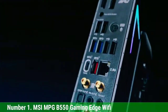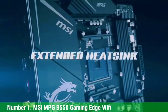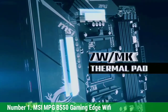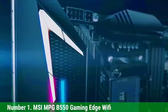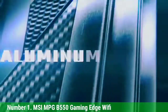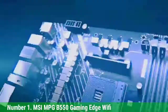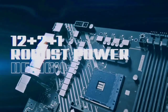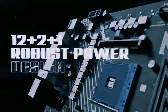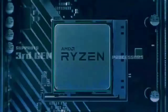The heatsinks are adequate — not exceptional, but capable of controlling temperatures at an intermediate level of overclocking. It has a total of 8x fan headers including CPU and AIO headers, making it perfect for installing multiple fans without needing a fan hub. For troubleshooting, it comes with easy debug LEDs that most competing motherboards lack, which is very helpful when the system doesn't boot. At the I/O, there's a dedicated USB port and button for BIOS flashback. It does feature a built-in Wi-Fi 6 adapter and 2.5G LAN, though the total USB port count is somewhat limited.